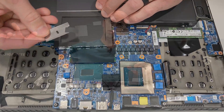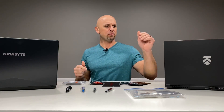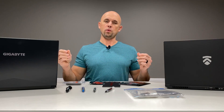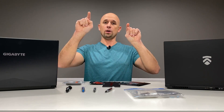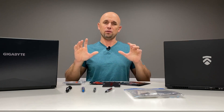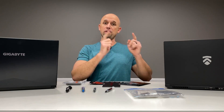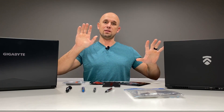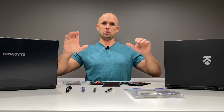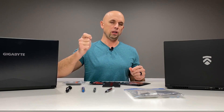Over the last five weeks I've been using the Carbonaut on the Aero 15. What's interesting about the Aero 15 and the MAG 15 is that the CPU die is in the shape of a rectangle. In a perfect world, the mounting solution would have four different screw points for ideal pressure to get the cooler to sit nice and flush with the die. That's difficult to do with the tri-screw solution on both of these laptops. Furthermore, the heatsink is shared between the CPU and GPU, so there are further discrepancies because a lot of copper is spread across the PCB on two different dies, and if it's not perfect — which it rarely ever is — it's really hard to get what's called good core uniformity.